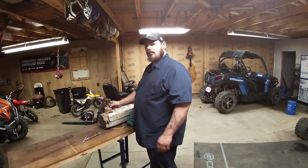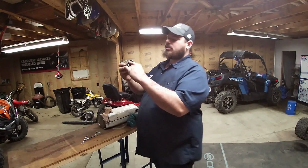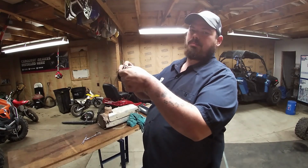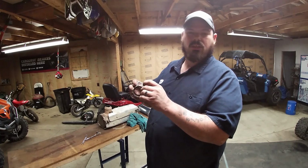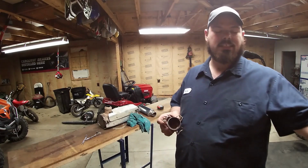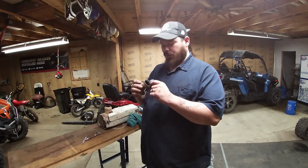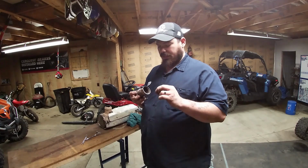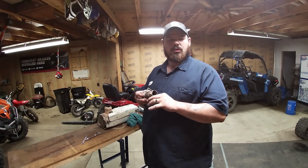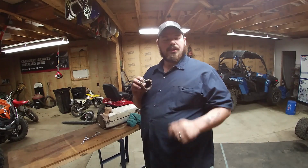Anyway, where it's welded at, you'll see where this flange is welded. You want to cut right on the first side of the weld coming up, because you still want this little lip to be there. Now, you could cut it down to this little lip so it'll fit inside this exhaust tubing, but we want a gradual slope. We don't want an edge that's going to be real bumpy and touchy for the air to not flow right. So we want a nice gradual edge into this because this is slightly smaller than a 2-inch pipe.